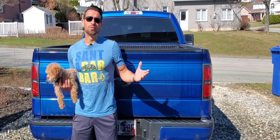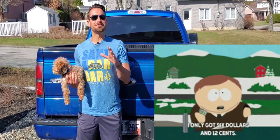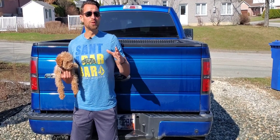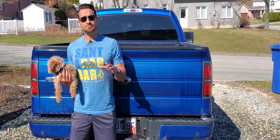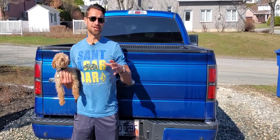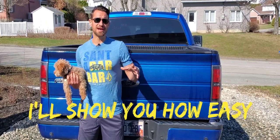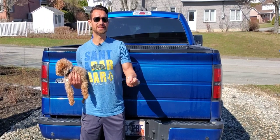One, I'm cheap. And secondly, I like to go with what's effective. So I've gone with a K&N metal air filter — it's a direct replacement for the OEM Ford air filter. This air filter is going to get more air into the engine, and I've made sure to keep my air filter box because I don't want that hot engine air going into the filter. I want to take exterior air and bring it to the engine.